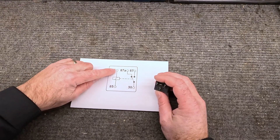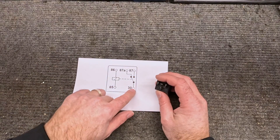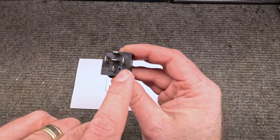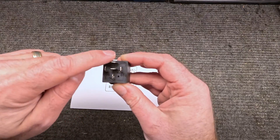The most common way these are run: you've got power coming in — a low voltage signal — into terminal 86, that goes through the solenoid, and when terminal 85 is set up to a ground, it will close this switch and send power from terminal 30 to terminal 87. So when power comes in through here and closes the switch, it allows power to go from 30 to 87.